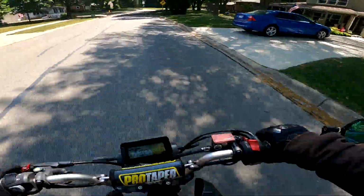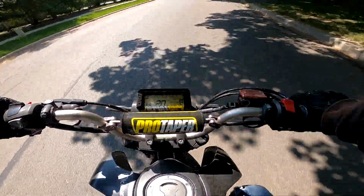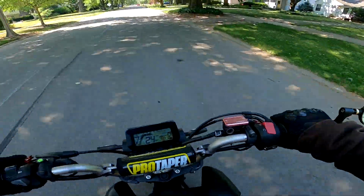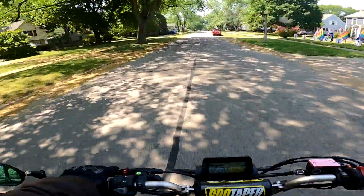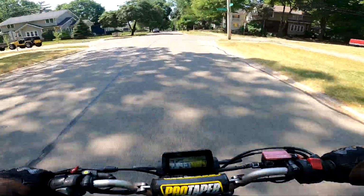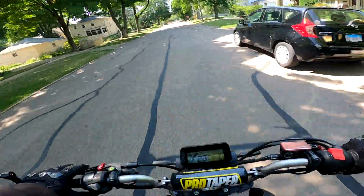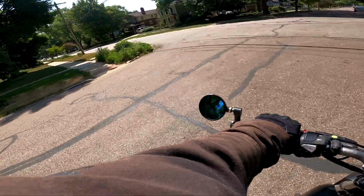And yeah, you can see I changed the angle on my brake a little bit because I wanted it to clear the throttle cables. So it doesn't really feel any different. I can tell there's a slight difference in the angle between the clutch and the brake, and I still got plenty of room to move my hands out from the brake. They're not too close. Like I said, I got these on the middle setting. So I think Trevor's gonna like this a lot more. The clutch is definitely more in the middle of the throw. It's closer to you. It's not as outrageous as it was. At this moment, I give these a 10 out of 10. I like them that much.